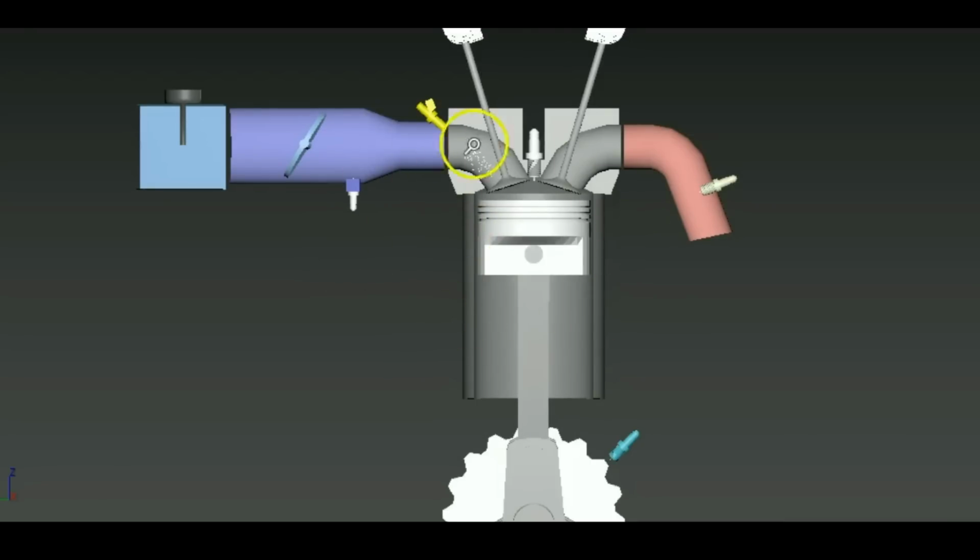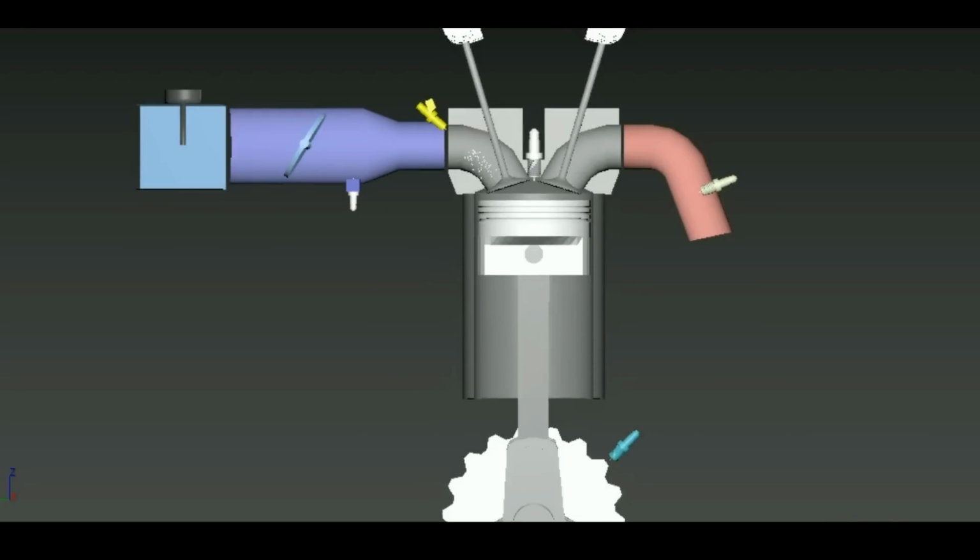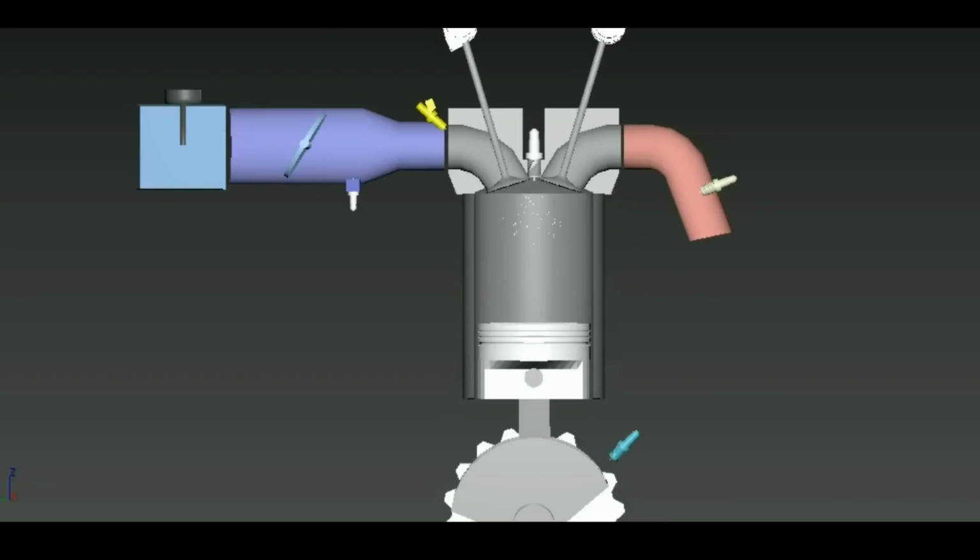But volumetric efficiency is how much air this engine can actually suck in on one given cycle, compared to its displacement. So let's say the displacement is 5 liters, but when the piston moves from top dead center to bottom dead center on this given cycle of the engine, it only draws 4 liters from the intake manifold. Then you basically do the maths, and whatever the percentage of that value is, that will be the volumetric efficiency at that load level.